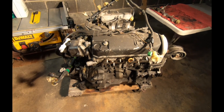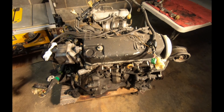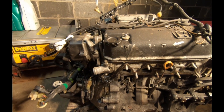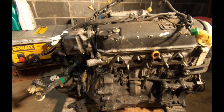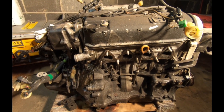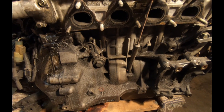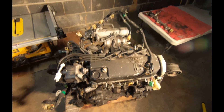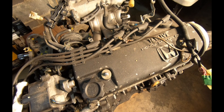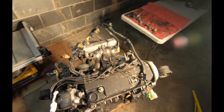Welcome back to the channel. Today I'm tearing down my A6 — going to take the distributor, intake, and wire harness off, along with all the brackets, because I'm sending it out to a machine shop. Those parts aren't needed and are pretty much covered in oil since it had a horrible oil leak. It needed a head gasket when I bought it — I replaced it, it stopped overheating, but it continued to smoke and still leaked oil from other gaskets. I never did a compression test on it.